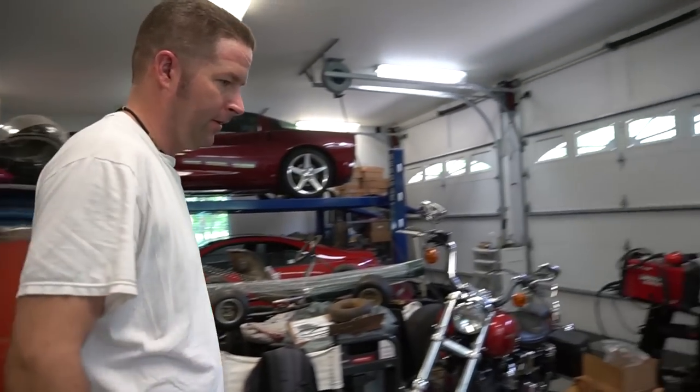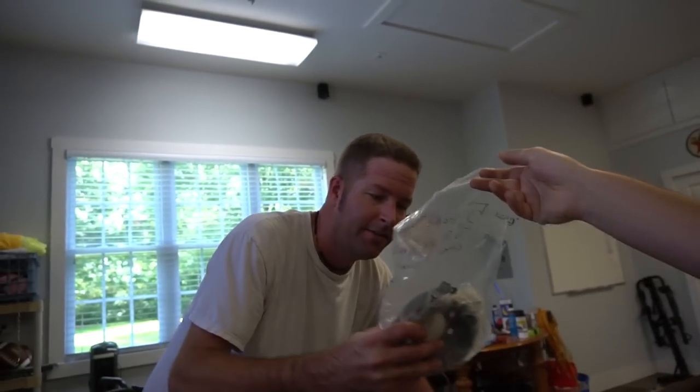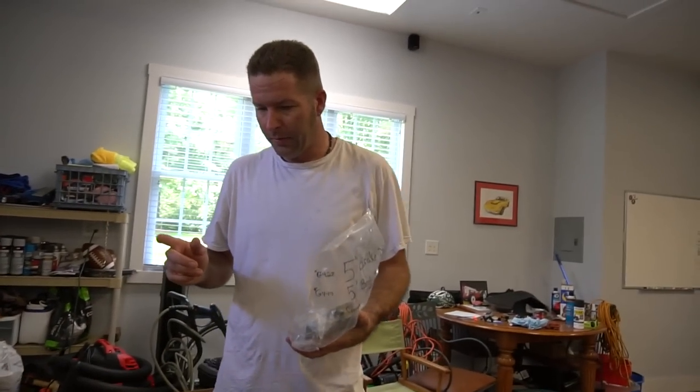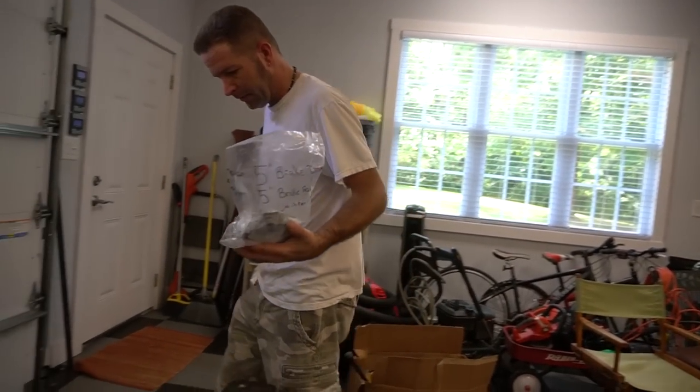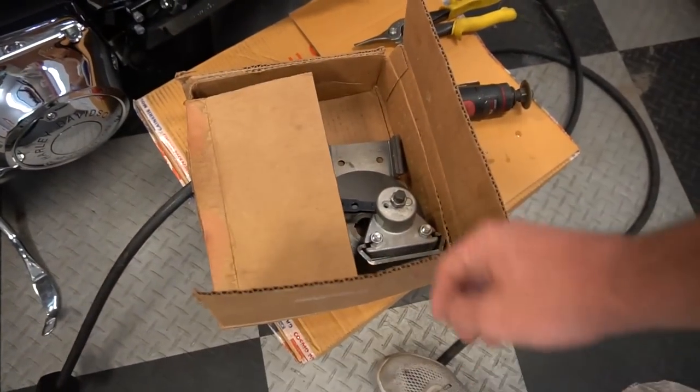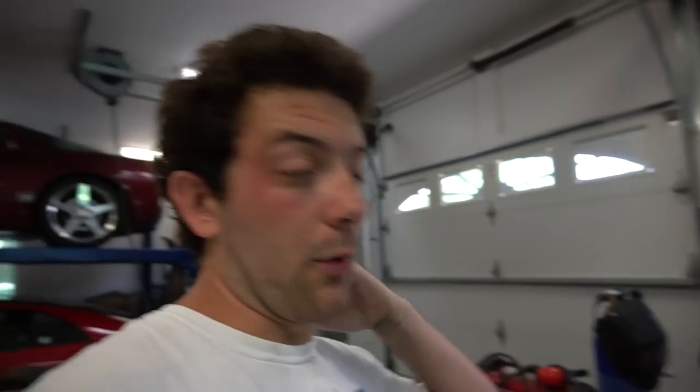It is a little warm out there. Brake time. We got a selection of brakes from Go Power Sports. We have a five inch brake drum with a five inch band. I think they also make a four inch one, but five is what we have. This one is a bit bigger than what I'm used to. I don't think we have enough room. We also have the mechanical disc brake that we've used a couple times — again, not enough room. We're probably gonna use the drum because it's got a smaller footprint, it'll fit in a tighter space.